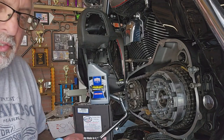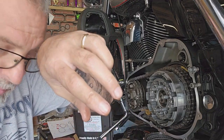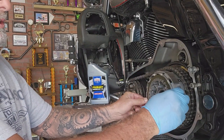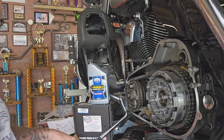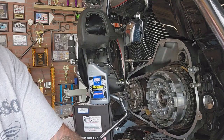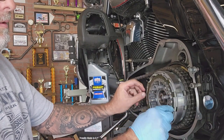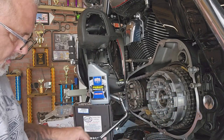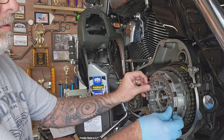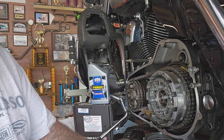I've had my discs soaking about 10-15 minutes in oil. Basically what we're gonna do — we're gonna start with the friction disc, slide it in, then a metal retaining disc, and keep rotating back and forth. You start with the friction disc and you end with one.